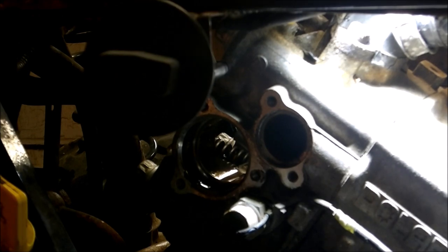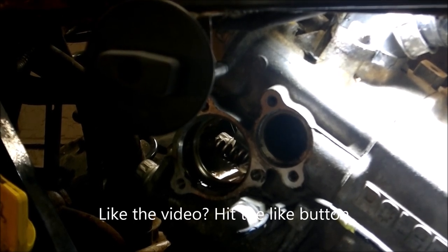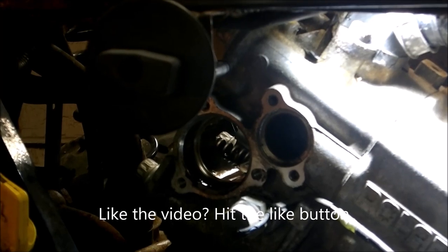When you want to install your new cam, just do the reverse of what I said. But there's one last step: you'll adjust the valve lash — it's 0.006. I posted a video on how to adjust that. So there you have it — it was pretty simple, nothing to it. Thanks for watching. Subscribe to my channel for more Polaris fixes. Till next time.